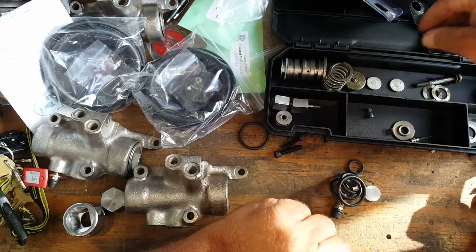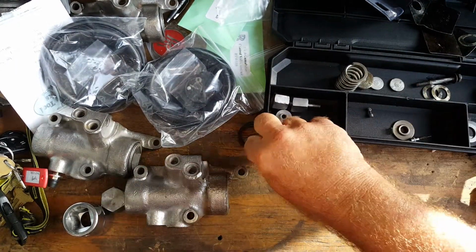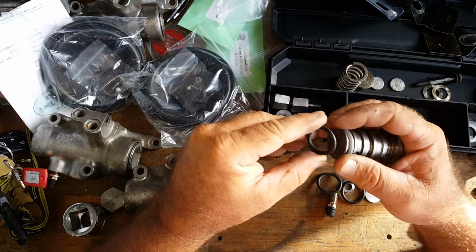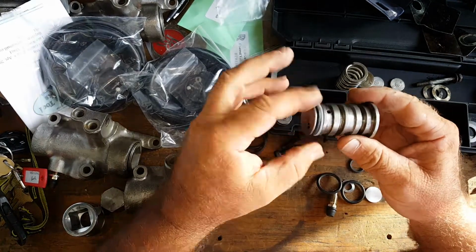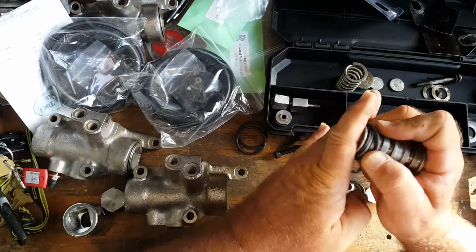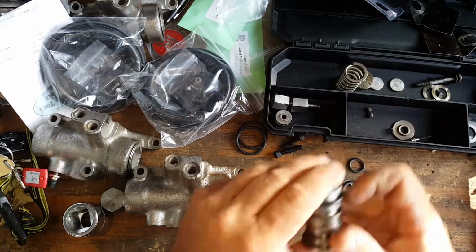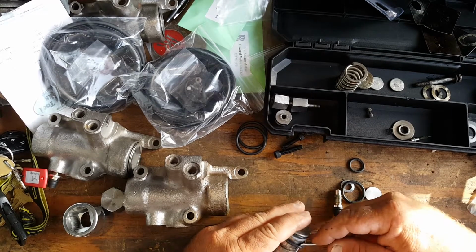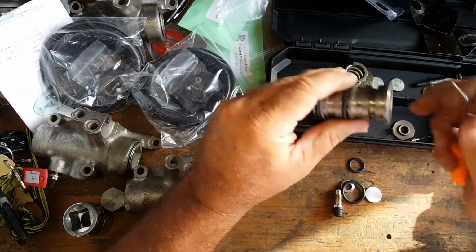All right. Again, we take the bobbin. We have our O-rings. We're going to set the big one aside. We're not going to need that right now. Set this in there just like that. There it is. And make sure that the nylon is on the back side. Go ahead and roll the other one on. Use our little bypass tool here to help roll it. Now you want to make sure you don't dig into that O-ring. Just like that.